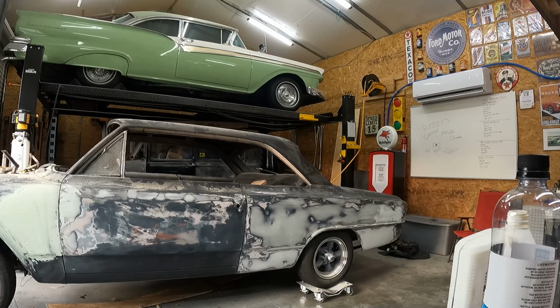So we can soak these in something. We'll put them in something and soak them so they get covered in oil. We can do that, or just a water line and something. That's fine. I just figured put a little oil in one of these containers here and roll them around in it. I have this, which is assembly lube. Put on the flat surfaces and the lobes of the cam.